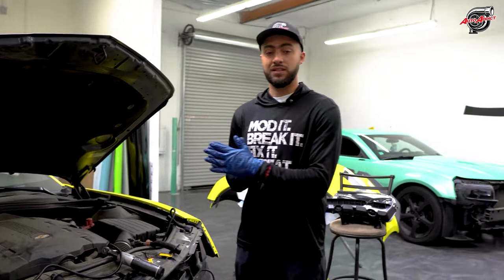Now we plug this in here. You hear a click. There's no lock in here because the car didn't come with it. And then this will connect to the OEM harness that comes off of the bumper. Now the second socket, same exact thing for the headlight. You hear a click. It does come with the red pin to close it. You push it in, and now your T-harness is fully functional with the turn signals, the headlights, and the parking lights on the fog lights.